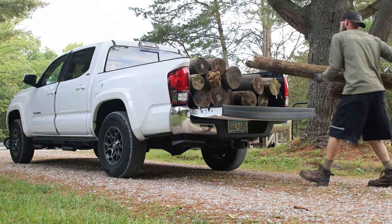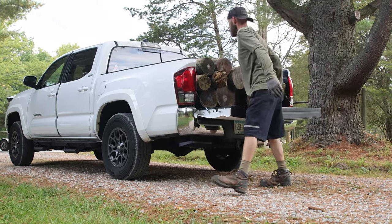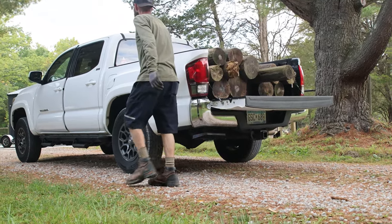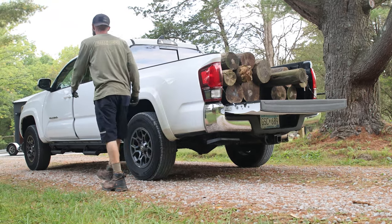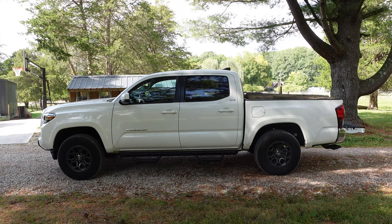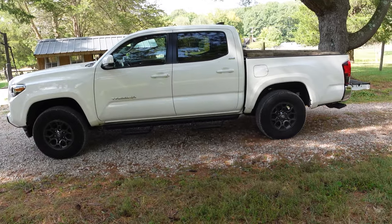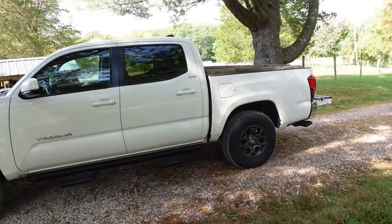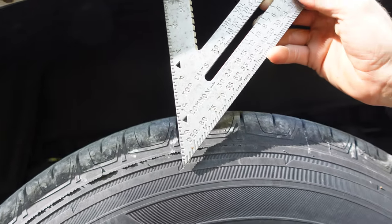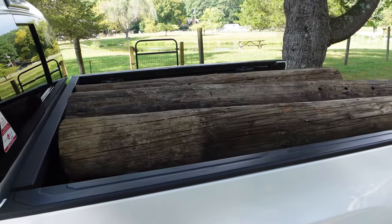We're going to load up the truck now and take a look at how it's all sitting. Looking from a little further back on pretty level ground, you can see there's really no sag after the SES kit is installed, which is pretty nice. We're going to do our measurement now. The measurement is back to basically five and a half inches, which is how it was pre-load — but we are fully loaded in the back. Definitely major progress.